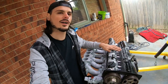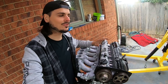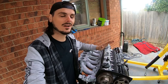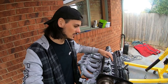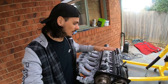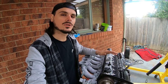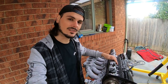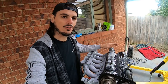For those who don't know, I hydro-dipped these valve covers over a year ago. I put spray paint in a bucket of water and hydro-dipped them — they looked sick at first, I'll admit they looked amazing — but because the engine gets so hot the paint just wore off. So what I'm going to do is sand them back, spray them black, and put some silver flakes over the black paint with a clear coat on top. I was originally going to go gold but the theme is black and silver so silver flakes it is — it's going to look sick.